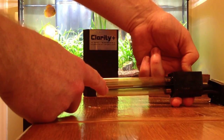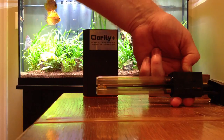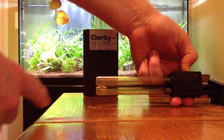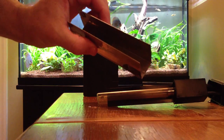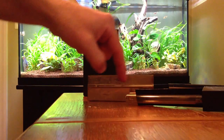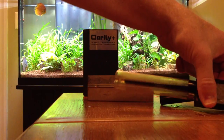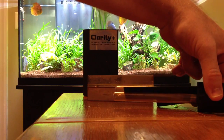You'll also notice that this unit has a baffle. A lot of models will try to maximize the exposure time of the water to the UV light by various means — some of them have a corkscrew, this one uses a baffle. Inside this aluminum reflector, the baffle slides in. So basically, you get double the amount of time of the water going over the UV bulb, just to increase the time the water is exposed to it.